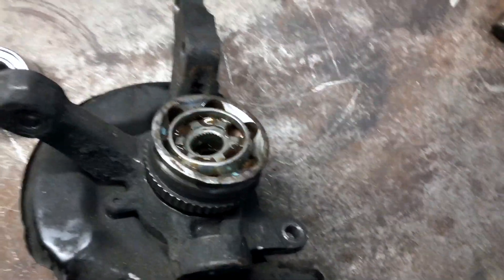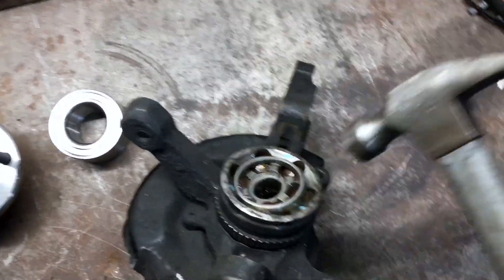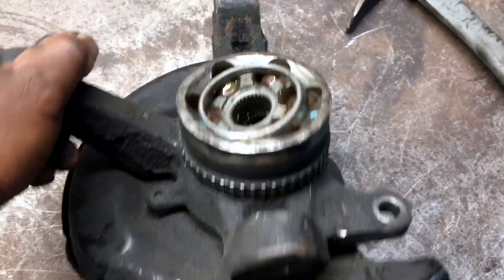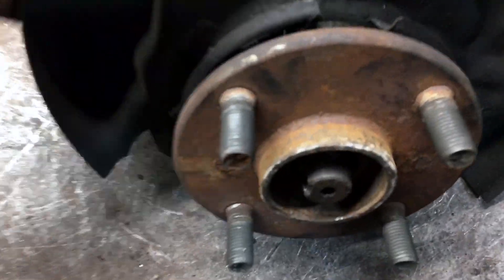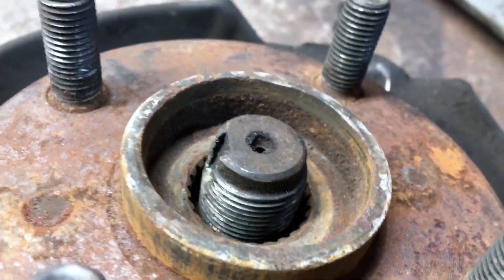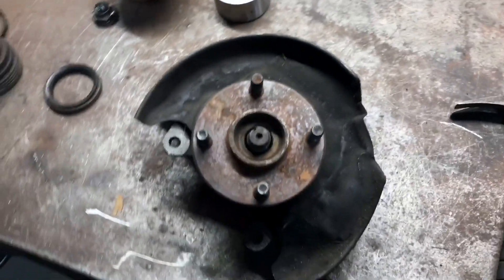Let me go ahead and hammer it down a little bit more. I think she's fully seated now. The way you know it's not binding - this thing spins freely, see that? It's not touching against anything inside there, that's exactly what we're going for. Look how much stud we have now - that's more than enough for the bolt to go on and lock into place. Feeling confident with this, we're going to roll with this.